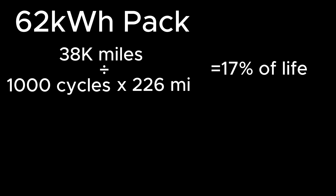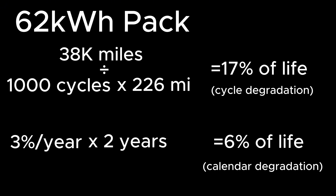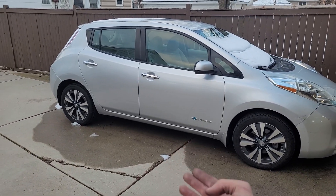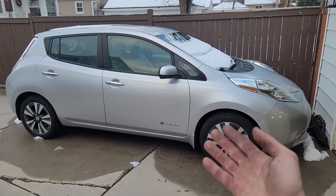For the battery that came out of the 2022 car, the 2022 62 kilowatt-hour range was 226 miles, and this battery only had 38,000 miles on it — that's 17% of the battery's useful life used due to mileage. Since the pack is only 2 years old, there's only an additional 6%, totaling 23% used, which means there's about 77% of the battery's useful life remaining. If it continues at about 20,000 miles per year, I can expect this pack to last another 120,000 miles easily — that's a conservative estimate. Next video I will be swapping the battery in, showing all the wiring and coding steps, and then I'll see the updated range and performance.